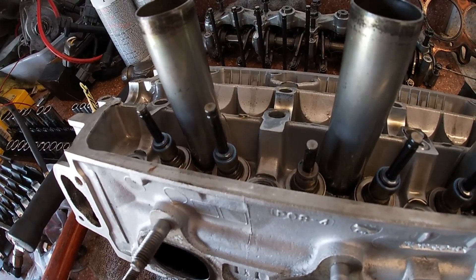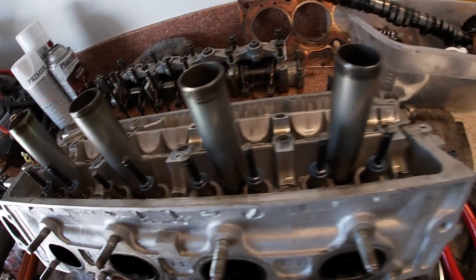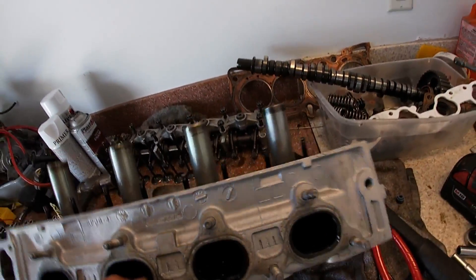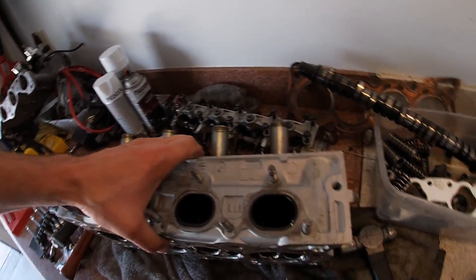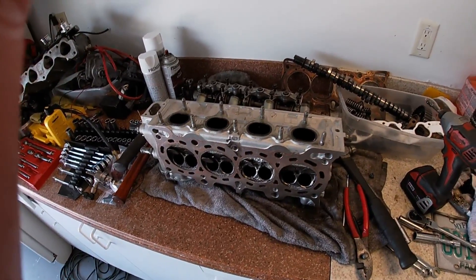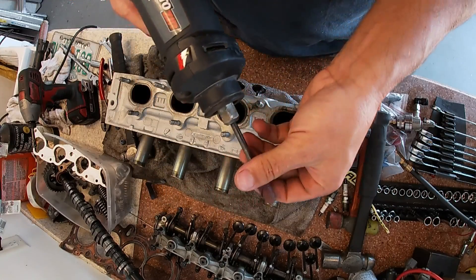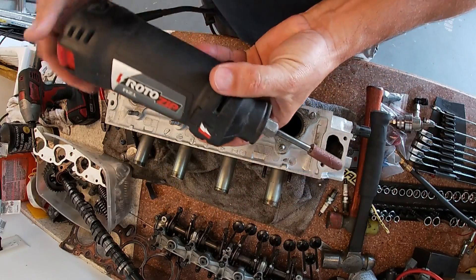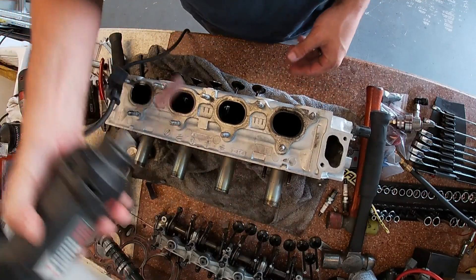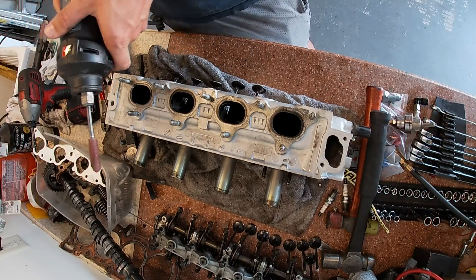Well, I'm going to have to grind them down or cut them off, one of the two. I don't want to mess up my guides in the process, so let me see what I can do. I'm going to go to the shed real fast and see what I can come up with. What I've decided is I'm going to use my Dremel — this is what I use for porting too. I'm going to use this and spin the valve and try to take off that little mushroom bend on it and see if I can get them to slide out.